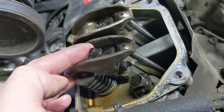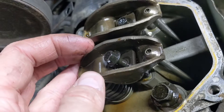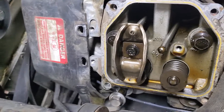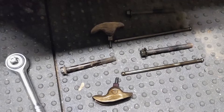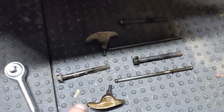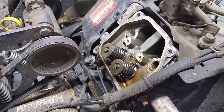In order to get these top bolts out you're going to have to remove your rockers. So I've unbolted the eight millimeter bolt — there's going to be a plate underneath it with that bolt, and we're just going to simply pull up on that. Then I can do the same for the other side and get my bolts out — you can see that clearance issue there. I've laid out my parts: the exhaust rocker and push rod here, the intake side over here, and my head bolts laid out in the order they came out so I know how to reinstall everything.